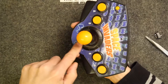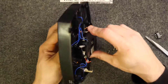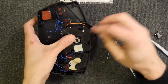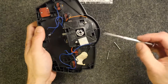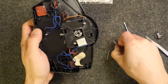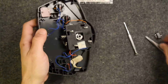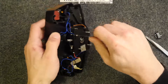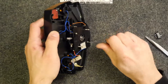This bezel here is actually screwed on from underneath, but it doesn't really serve any purpose other than aesthetically. So if you want to get the actual stick itself out, just prise a screwdriver in here and pull that circlip straight out, and then you can re-site that whole thing. You can even use this plastic as a template for how big to drill your hole in your little arcade cabinet.